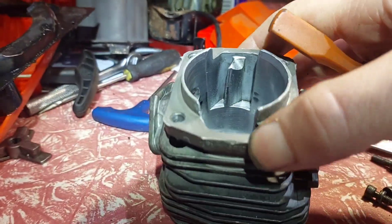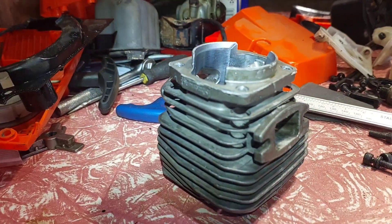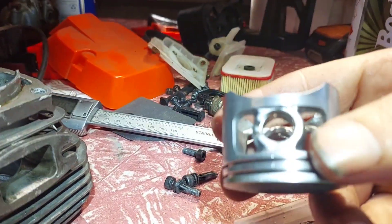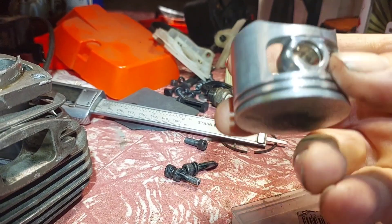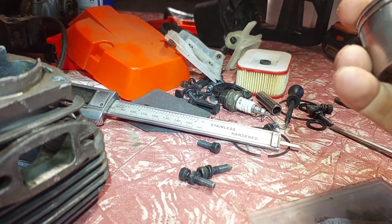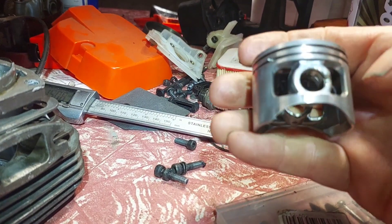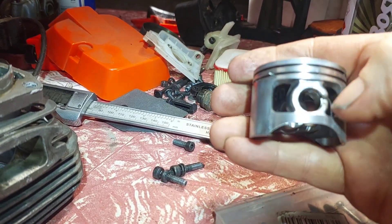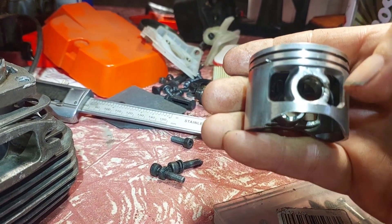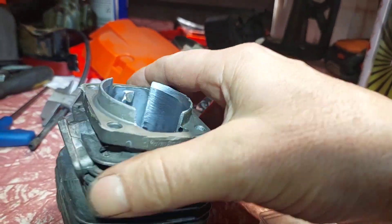I want to improve that airflow but I can't go through the sidewall, so I'll be careful how much I do — just take your time. The windows on the piston are very small so I want to open them up, especially the one towards the back of the cylinder. The one on the left I want to open up because it's already exposed to the transfer. The exhaust side one on the right isn't really opened up at all, so I'll open that up a tad.